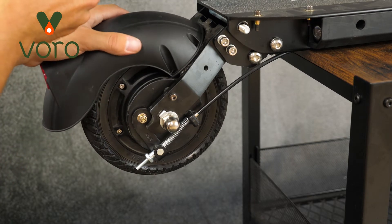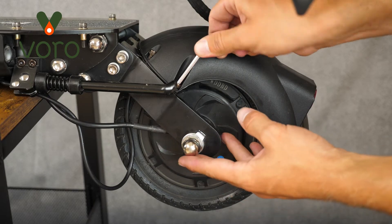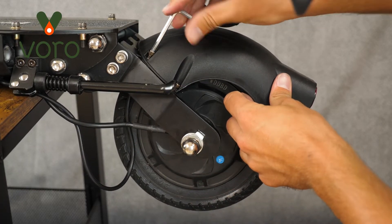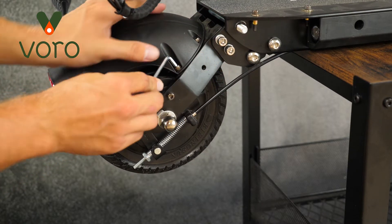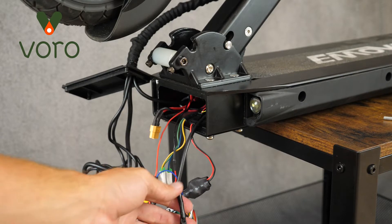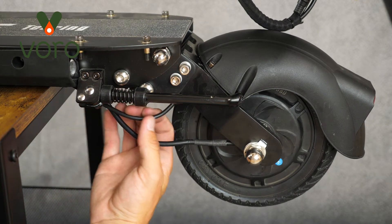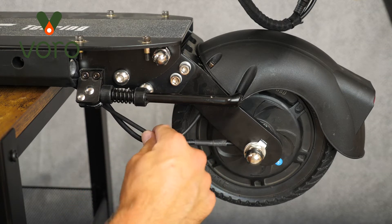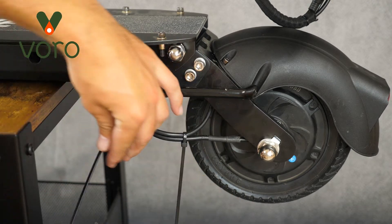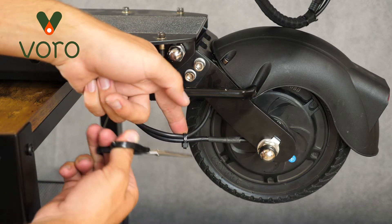To reinstall the fender, use the same four screws from earlier and screw those right back in. We recommend doing the two furthest screws first just to keep your fender in place while you do the other two. Once all those screws are in, tighten them up to make sure the fender doesn't move. We have a little bit of excess fender wire, so go to the front of the scooter and pull that wire through just a little bit more to take up some of that slack. Don't take up too much slack though — we still want some of the fender wire in the back so that we can zip tie it to the motor wire. This keeps everything looking clean and helps keep the wires from rubbing against the wheel. We decided to use two zip ties — go ahead and cut off the tails when you're done tightening them.